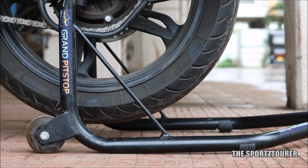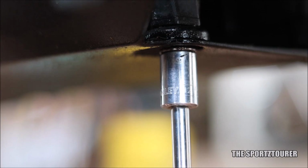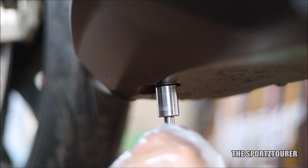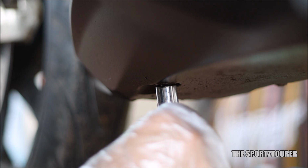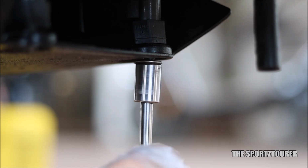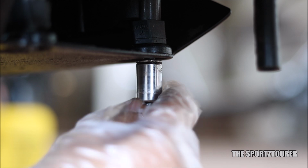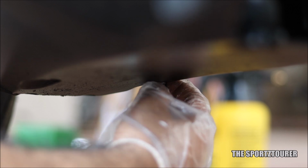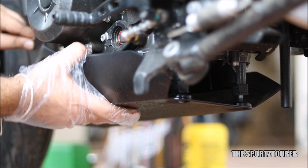With the rear wheel up, I prefer to start this by removing the belly pan, as a lot of sludge and dirt deposit from the cleaning process gets deposited on the belly pan. If you plan to wash your motorcycle after cleaning the chain, then you can totally skip this. This underbody panel is secured by 4 12mm lock nuts, which are easy to access. My other reason for removing this panel is to use a trim restorer on it. Let me know if you want a video of it.